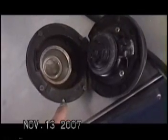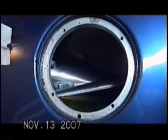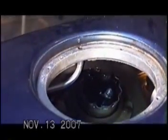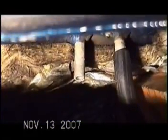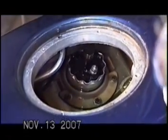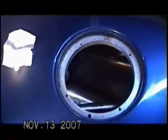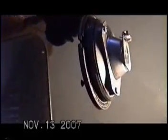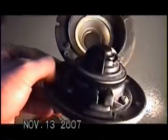This little notch here has to line up with the hole on top of the gas tank — that's your vent tube. I blew compressed air into this vent hole and found it comes out on the bottom. This rearmost tube on the lower right bottom corner of the tank connects with that vent hole. I replaced it about five years ago because having it out of the tank for an extended time caused it to seize. I bent that rod up a long time ago so my gas low light comes on at around 120 miles. An important item is replacing these seals — they run maybe $50 for all of them. If you rebuild your gas cap you'll help keep water out of the tank, and you can also grease the inner mechanism so it doesn't stick.